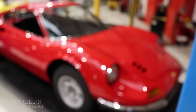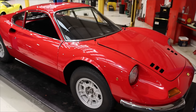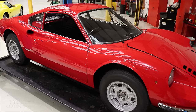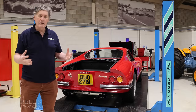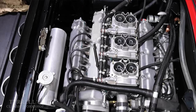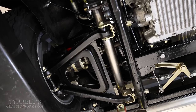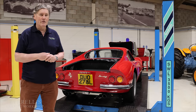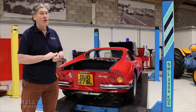We've been trying to get this finished for the owner as quickly as possible, and from two months ago with a completely bare chassis and body, we now have a car standing on its own four feet. The reason for this is that we restored all the components as modules — engine, gearbox as one module, brakes and suspension as different modules on each corner — so when the time came we were able to slot everything together just like a great big model kit.